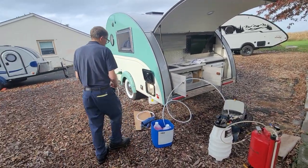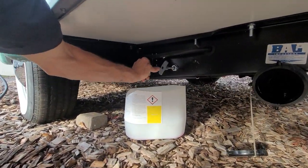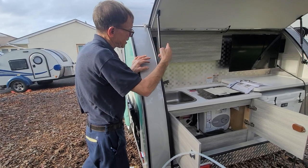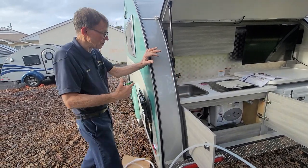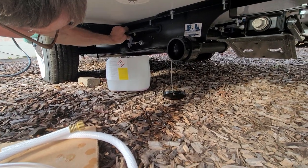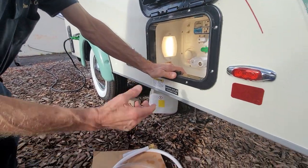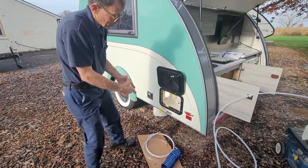The first thing I'm going to do is drain my low point drains, which are right here on the frame rail. We open them, and we also open the faucets — both the sink in the bathroom and the sink in the kitchen — and we flush the toilet. Put the faucets to the mid position between hot and cold. After it all drains down, you close your low point drains. I'm also draining my gray tank, because I want any water in it to drain completely. I'll close it right before I finish and put some RV antifreeze down the traps to protect the valve so it doesn't freeze up.